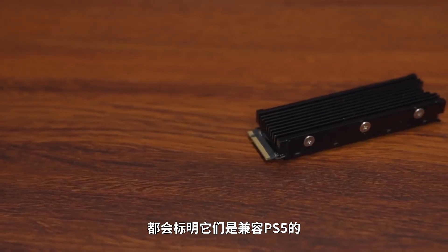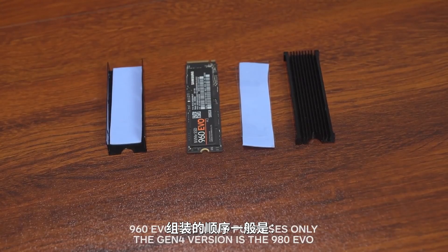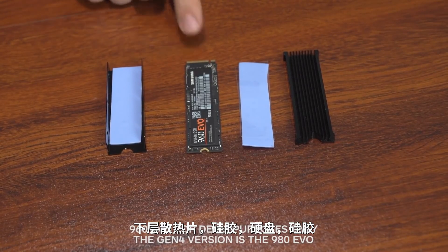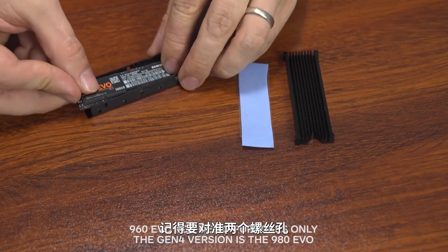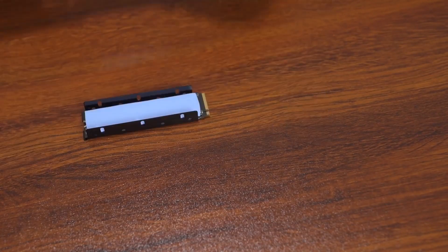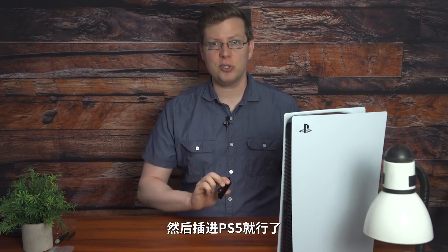Now, let's say that you have a hard drive that doesn't have an included heatsink. I'm going to show you how that's done with this old M2 drive I had laying around and a heatsink that I bought. Most heatsinks on Amazon or wherever you purchase them are labeled as compatible with the PlayStation 5, but you can find a full list of specifications on the PlayStation website or in the description. Never put on your own heatsink? They even come with instructions. The order is: your bottom, silicone thermal pad, your M2 drive, silicone thermal pads, and then the cover. Screw it together and put it in the PlayStation 5 like I showed you before. Make sure you line up the screw hole on your drive with the appropriate screw hole on the cover, then screw it into place and install it in your PlayStation 5.